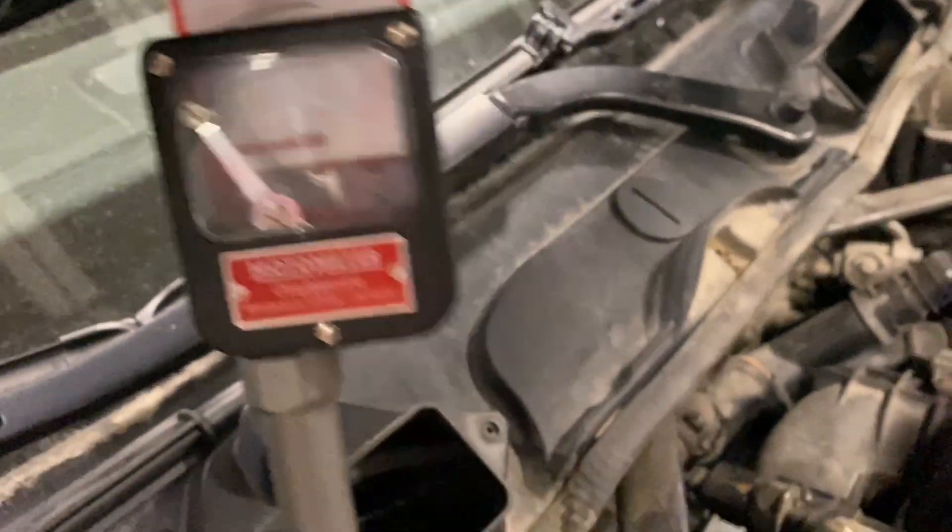Yeah, there's no compression. Okay, that was about it with this job sadly - kind of game over. We're going to see what happens. I could maybe make a follow-up video but usually with engine repairs such as removing the cylinder head, they often get given to someone else, so I'll probably not see this job again. Let's have a quick look inside this cylinder - you can see these particular marks highlighted there, that's literally water and oil mixed emulsion, like a coolant mix.